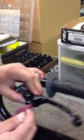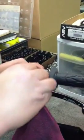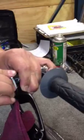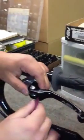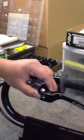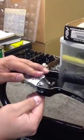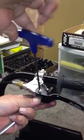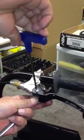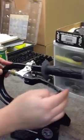Pull it back, coil the spring out of the way so the lever's in place so you can put the bolt through. Slide the main pivot bolt back through both the blade and the knee. And now pull the rag out, put some tension and pull the rag out from the spring. Put your lower nut on, and you've now reassembled your ASV lever. And it's ready to use. And when you're all done, it should have tension pulling the lever back into place like it did before.